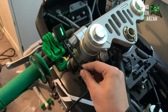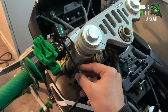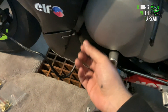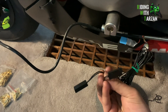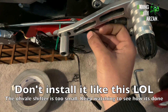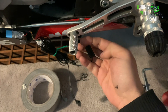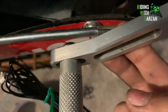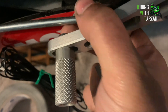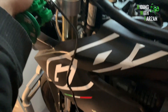What I have here is a gear indicator called a universal magnetic gear indicator. These magnetic gear indicators don't talk to any ECU — they are very simple electronics. They're connected down to two sensors, which you mount with notches — one for shift up and one for shift down. They pick up a magnet, which I've placed right over here. You JB weld or tape the magnet down, and as you move the shifter up and down, the magnet feeds into the indicator screen, which goes from zero all the way to six.